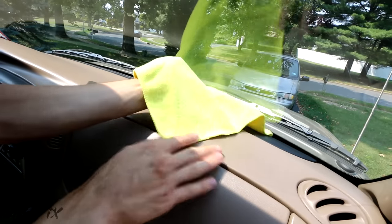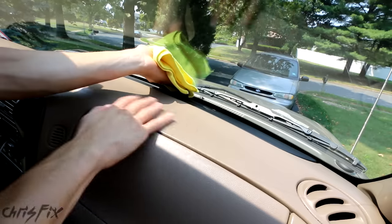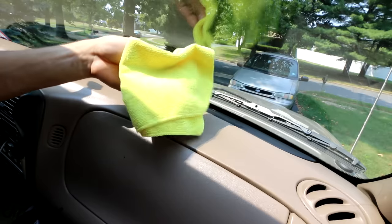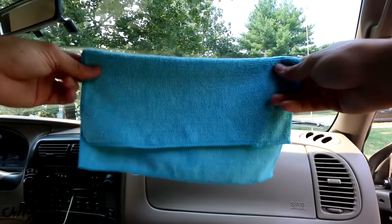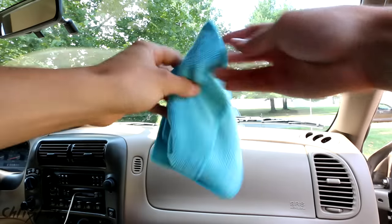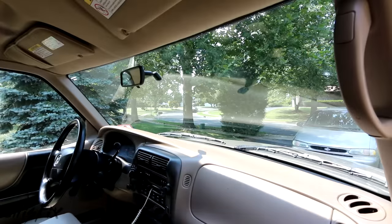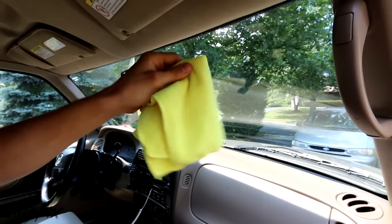As you clean, try not to let the towel touch the dash. Keep it nice and folded and controlled so you don't get any grease from the dash onto your towel and then rub that grease back onto the glass. If you do get the towel on the dash, that towel is done — throw it in a wash bucket and grab a new towel. If you don't have microfiber towels, I'll leave a link in the description — they're relatively inexpensive and reusable. You can also use regular paper towels, they just don't work as well. The first step of wiping down the glass in circular motions, then straight up and down with a clean dry towel, is done.